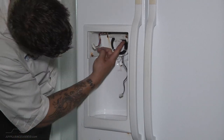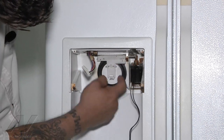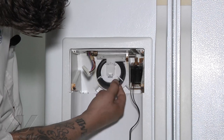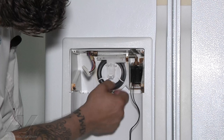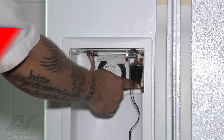Now we can see our solenoid and our flapper up here. Here's our flapper and our solenoid — they're all connected to work together. There's a lot of corrosion on the plunger for the solenoid. If I open it up, it's so corroded it doesn't want to slide back up freely to allow the door to close. So we'll get an estimate to replace this solenoid assembly.